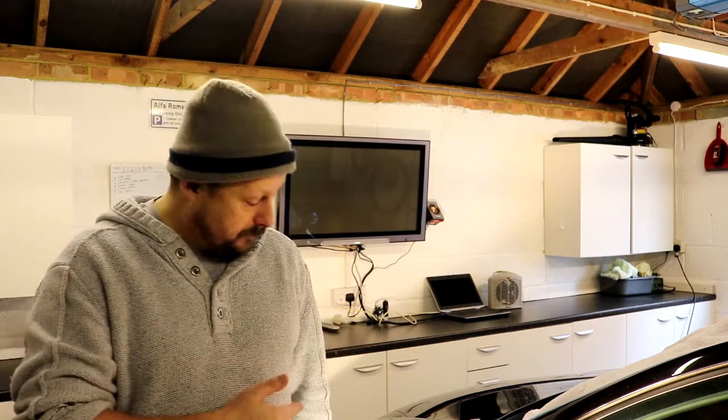So the fact that I upped to a slightly more aggressive compound, worked it a little bit harder and managed to get all my defects out in one pass was great. And I knew from polishing the bonnet previously that I was close to getting all the correction done in one pass. So again, that's why you do test areas. So we got all our correction out in one pass. There were some micro scratches in there that the polish took out in the second stage of the work, and it gave us that lovely gloss finish.